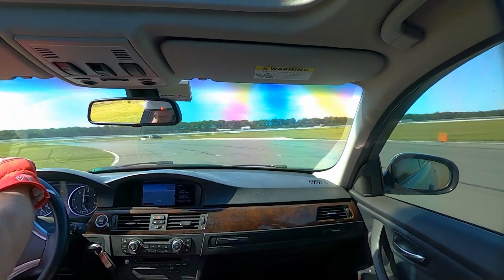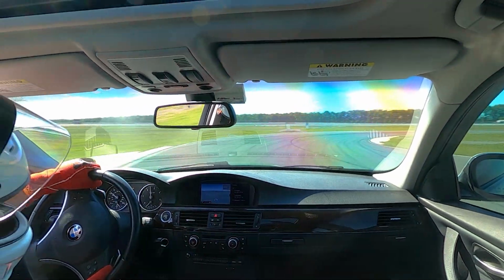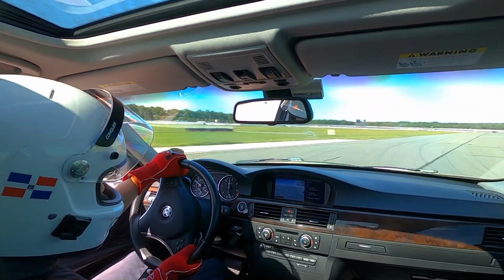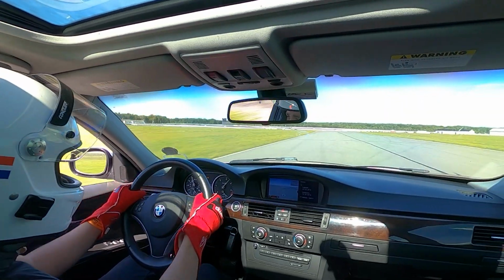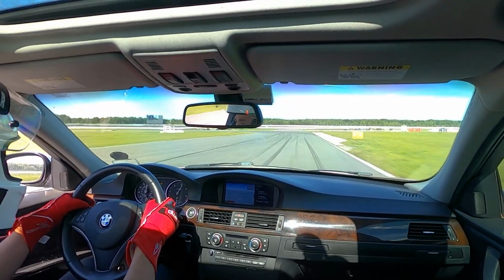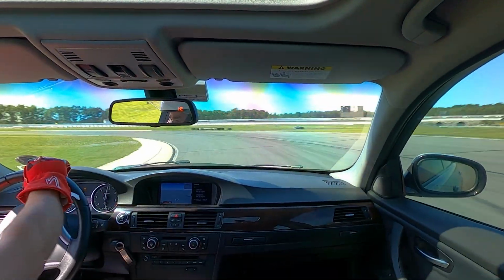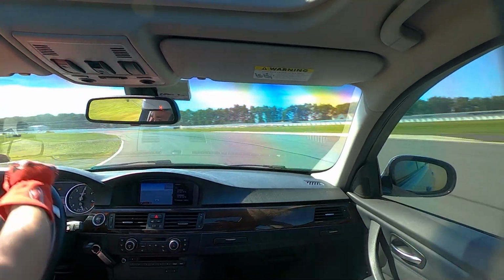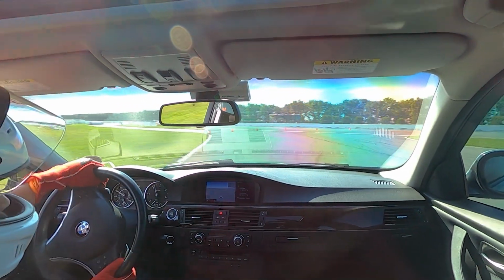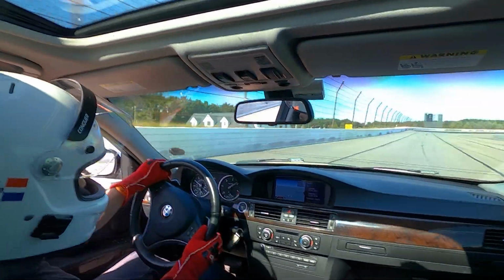So by now, you've probably noticed a few things that I want to cover about this car as it sits. Like I said, it's a commuter car right now. So first, the tires. Yes, the tires are pretty bad. They have like no grip at all. And for session 1, I didn't even have the chance to air down, right? So they're at 35 PSI all around, basically. A little bit too much PSI to begin with. So the grip is just not there for this high horsepower car.